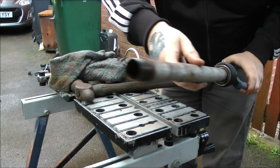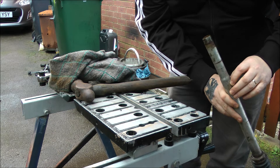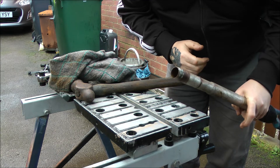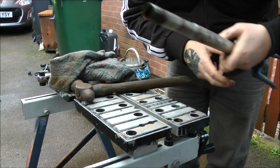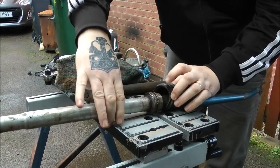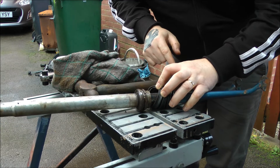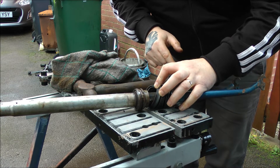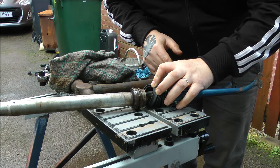There's also supposed to be a screw right up there but I can't see it — I think someone's been in this before and managed to remove it, which is supposedly one of the really difficult bits about rebuilding the forks. There's also a fitting there that needs a C-spanner to remove it. I'll probably need to put a little bit of penetrating oil here and there just to make life easier for myself.